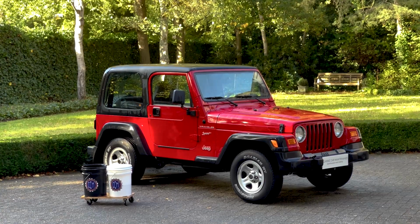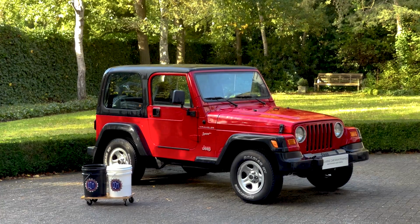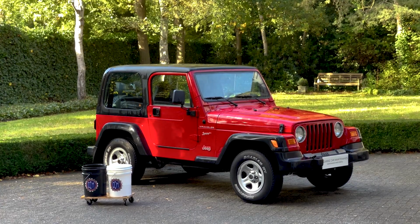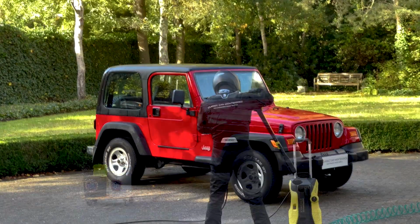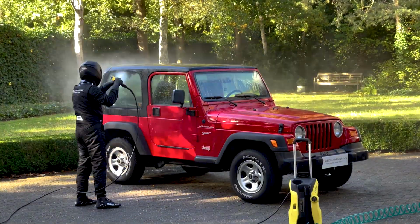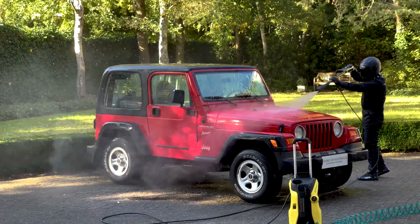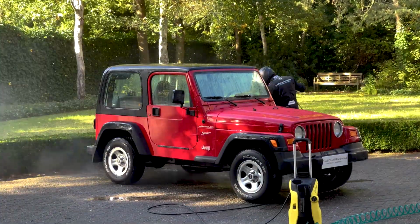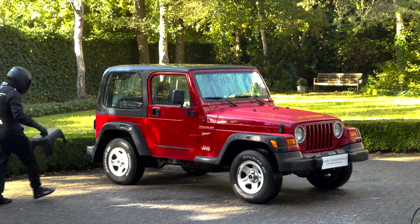It may be kind of counterintuitive at first, but once you get the hang of it, you'll see it works very well. The tail end of your vehicle will be the dirtiest, especially the lower end around your exhaust pipes for vehicles with a combustion engine. That's why you want to wash this part of your car last. When you're done washing your car, don't let the soapy water dry because it will leave spots. You want to rinse it off without delay. Again, hold your pressure washer nozzle at least 1 foot from your car and blast it at a safe 45-degree angle.